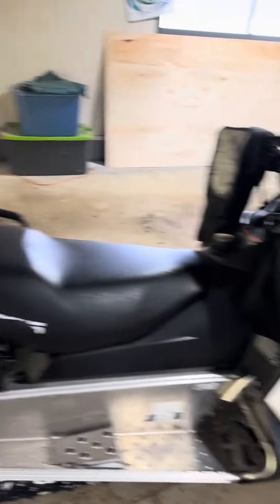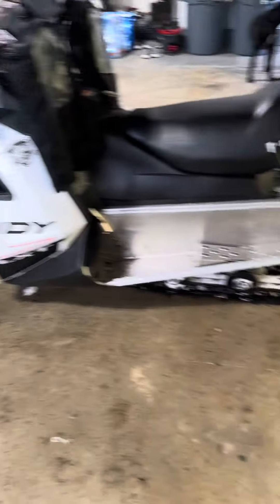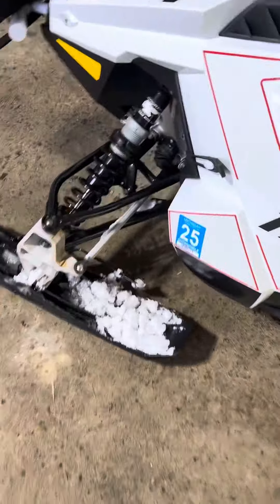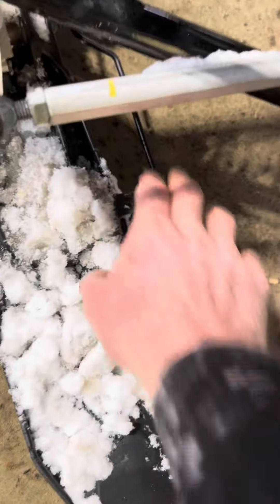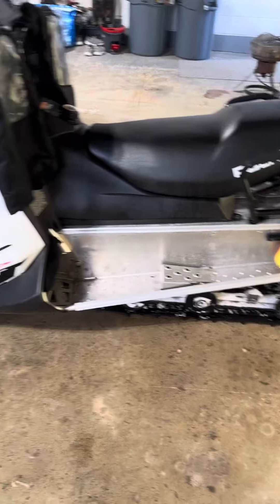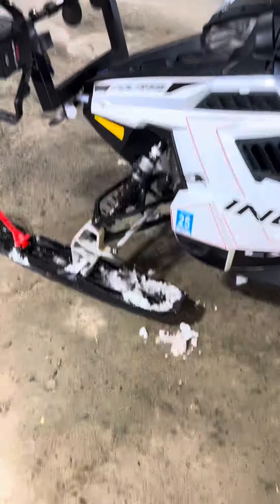Sometimes we have a huge lack of snow on the ice and you got to put scratchers on. I don't really like the scratchers that go on the tracks — the cables kind of suck. They throw some snow behind your track but it doesn't get under. What I use is the ski mount. There's a lot of down pressure on those carbides. They just lift up and down and hook back in, and those seem to do a lot better for me than the cable scratchers. The only bad thing about them is you can bend them up if you forget to put them up before loading into the trailer.